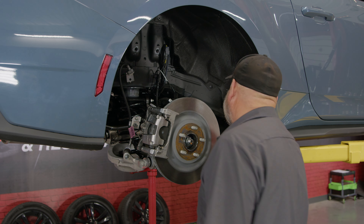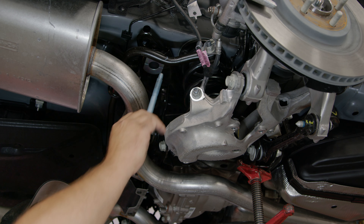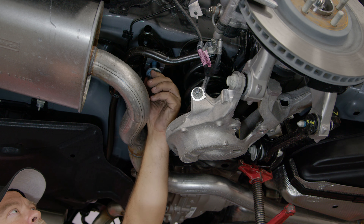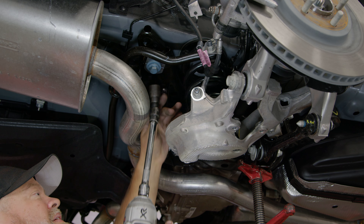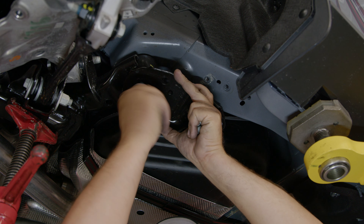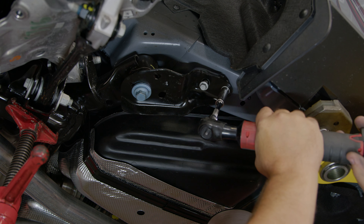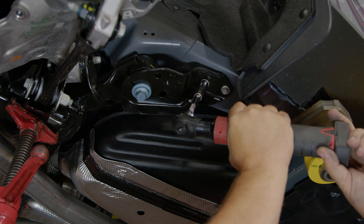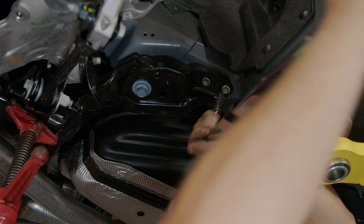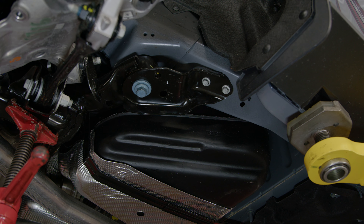You'll find that because we're lower here, it's closing the gap much, much easier. Make sure both ends of the coils are seated properly. Jack the subframe back into place. Now reinstall the subframe bolts — definitely start them by hand and make sure they're centered. Torque the smaller bolts to 41 foot-pounds and the larger subframe bolts to 129 foot-pounds.